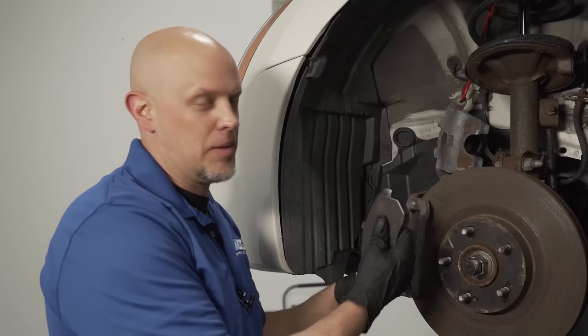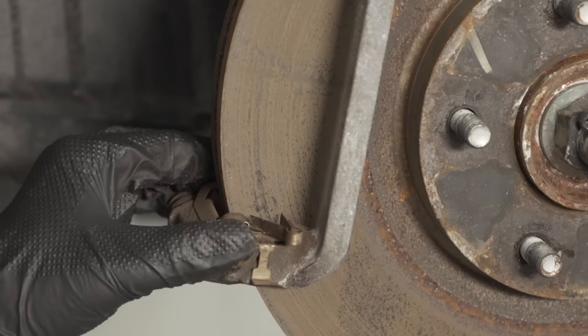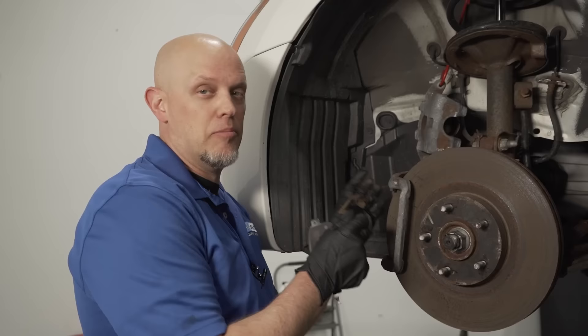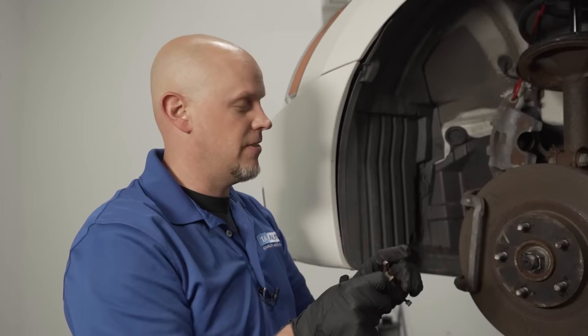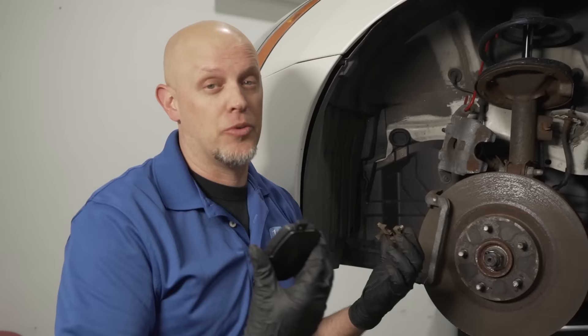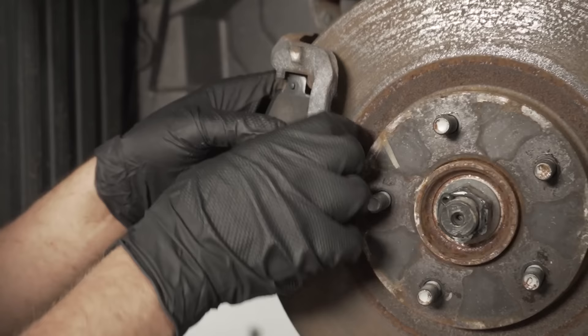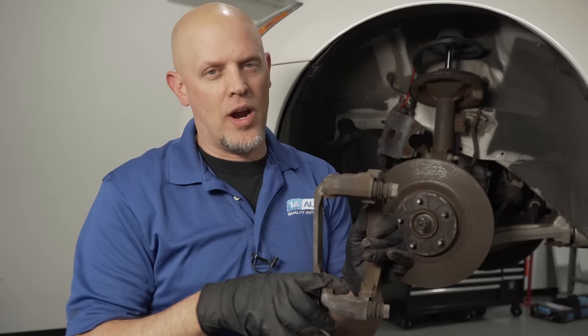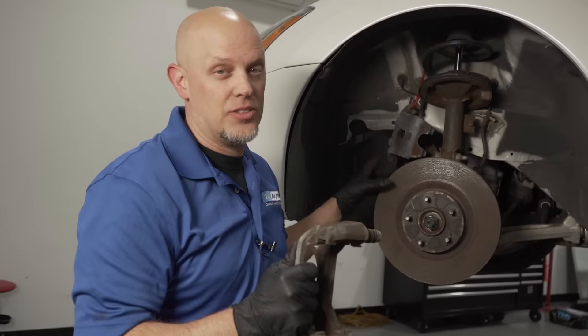While we're talking about brake pads, let's talk about the brake caliper bracket where the brake pads sit. You have pad slides or anti-rattle clips — they keep the pads in place and keep them from rattling. If you put these on wrong, they could rub against the rotor, and sometimes they are side-specific and will cause other issues. Make sure you put these on correctly and that they're not rubbing on the rotor. Reuse or replace them — clean them up with a wire brush. The bracket itself, if it's rusty, clean it up where the pad slides go, or the pad is going to stick, causing too much material touching the rotor and making your brakes wear much faster.